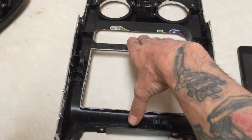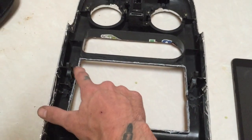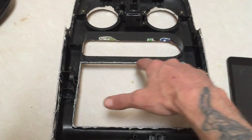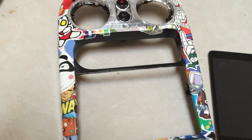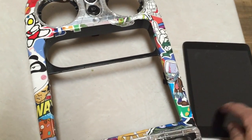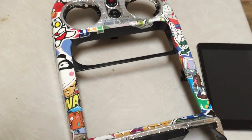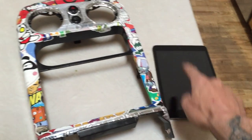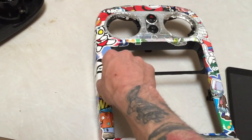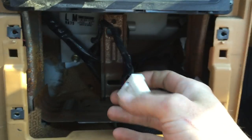Now that the iPad is ready to mount, I've got to strap it in somehow. Power will be coming out here and audio coming out here to a wire going over to a potentiometer knob, so you have actual hard-line control on the audio going to the amp. That's easier than finding buttons on the screen, and it also gives you a better signal to the amp because you're sending out a full signal and adjusting volume level with the potentiometer.